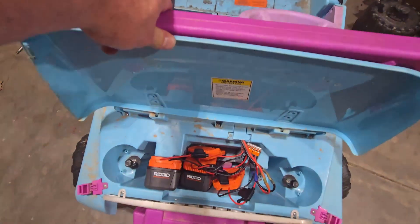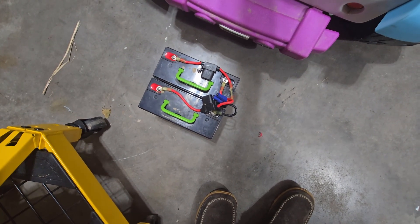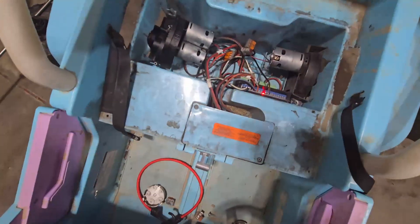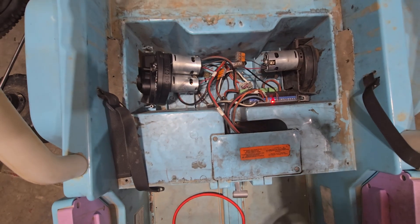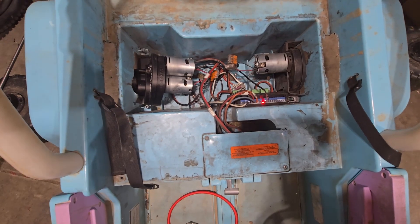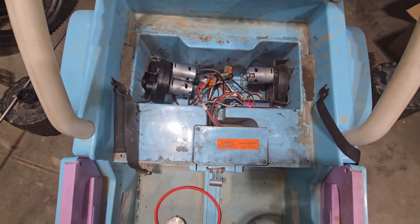So what I'm going to do — we were running two lithium iron phosphate 12-volt 20 amp-hour batteries in series. Normal voltage is about 28 volts out of those, and we're running those with a single 887. We're switching over to Lyle's 3D printed dual gearboxes with first gear delete. We're going to try running this not for racing, but just around the yard. We'll see how reliable the gearboxes hold up for hours of use.